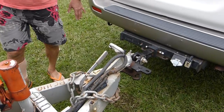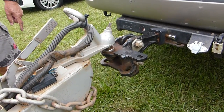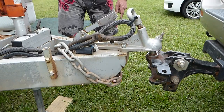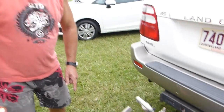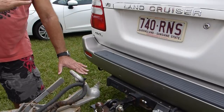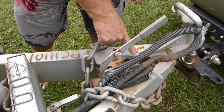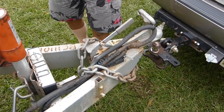All we have to do now is just pump it up and take the car away. Give it some space though. Now, what just happened then was really interesting — because of the angles we were on, we had to actually lift it quite high, and that made the whole thing shake. That's one reason we have our wheels braced and also the handbrake securely on. And as you notice, it may have shaken, but it didn't move. We're now just going to move the car forward, just off from where the ball would actually go on.